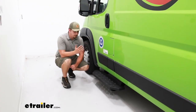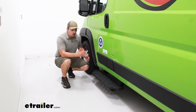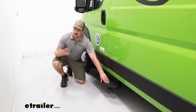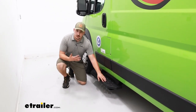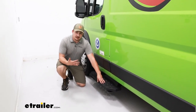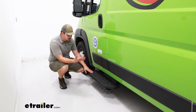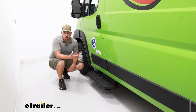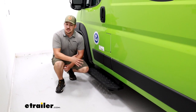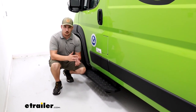The driver's side repeats pretty much the same process as the front two brackets on the passenger side. Just remember that the second bracket is a little bit different than the first — it's not a perfect mirror image — and back there we don't use the M10 bolt plate, just two of the M8 nut plates. Other than that it's just a mirror image, and it's a much smaller step so it's easier to work with. And that'll do it for our look at the installation of these Aries Ridge Step running boards on our 2023 Ram Promaster 2500. Thanks for watching.